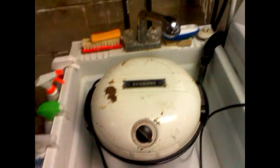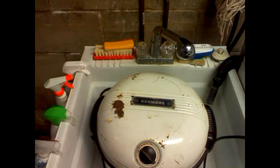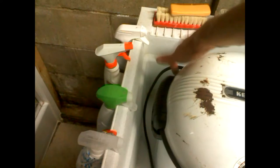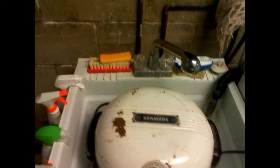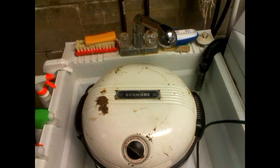The original cord also didn't have a ground hookup like this one does. The ground inside isn't hooked up to anything — I just cut the ground wire off since there's nowhere to attach it. To start it, you basically just turn it on. It might take a second. That's what it sounds like. It uses 90 watts of power according to the metal spec plate. The timer doesn't draw any power. One horsepower is 746 watts, so I think it's either 1/7th or 1/8th horsepower.